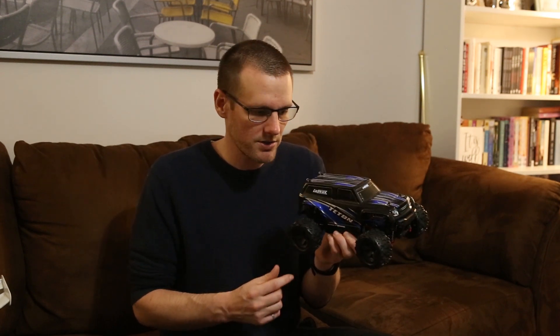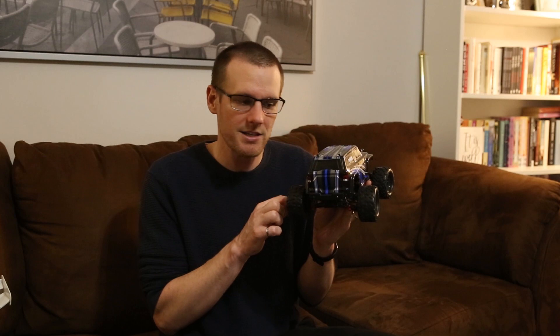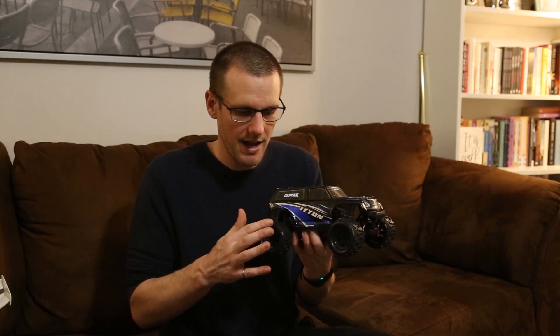What I do is I go and rotate one wheel and check for any type of binding — any sort of resistance that doesn't feel normal. Usually a binding occurs in one spot or several spots and it's not continuous. You rotate the wheel around and check for that. What we're doing is operating the shaft, the CV joint, and turning the entire differential as well. I go ahead and turn this wheel forward and you see that the other side is turning in reverse — that means everything in this whole rear end is rotating and I do not feel binding. You do the exact same thing with the front wheel to check if there's any issues there. I'm going to hold one wheel fixed and rotate another — here I do not feel anything that is abnormal. Everything feels smooth, no binding issues in this radio control vehicle.